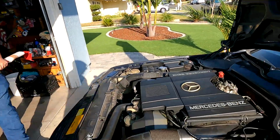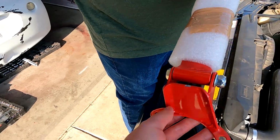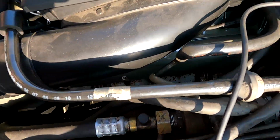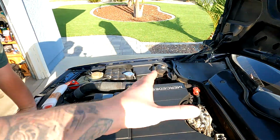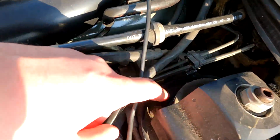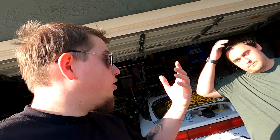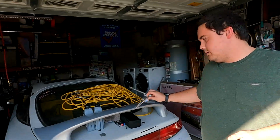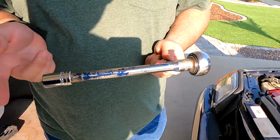All right, let's get into it. Let's just show really quickly. All you have is those bolts right here. They're the same on both sides, and they go to your strut bar towers. One is right here and one is right here, and the exact mirror image on the other side. You don't even touch the third one right here, just the 2 in the front. It's also cool because this way you don't have to worry that if you take out all the bolts at once, it's gonna fall over. All you're gonna need is a ratchet, a 13mm socket, and an extension, and that's it.